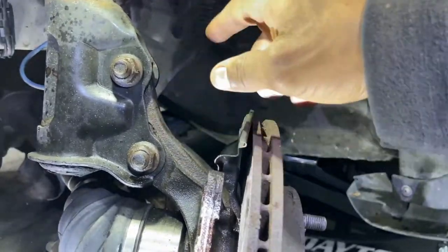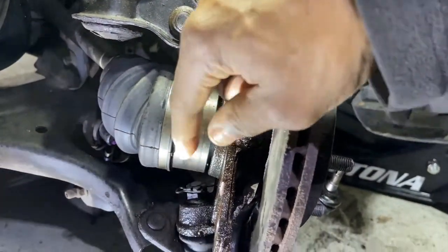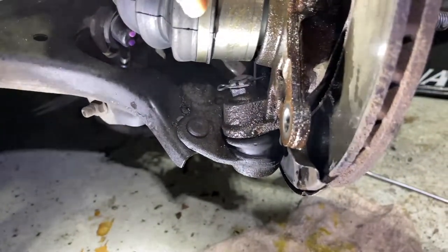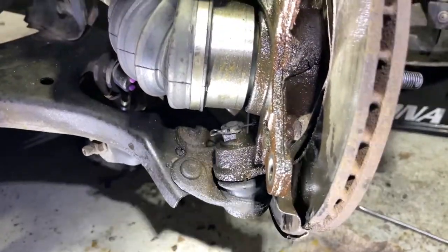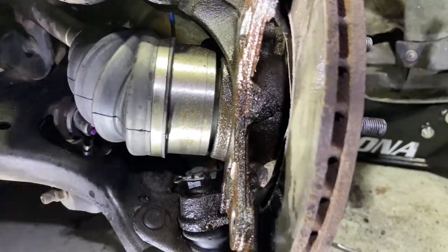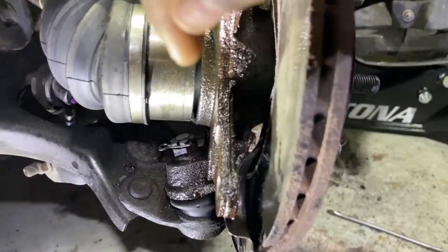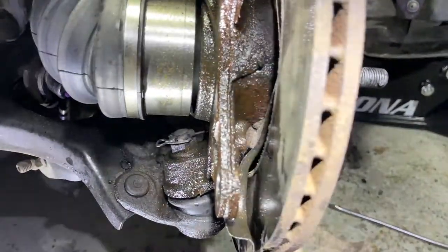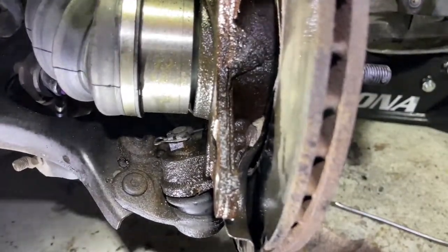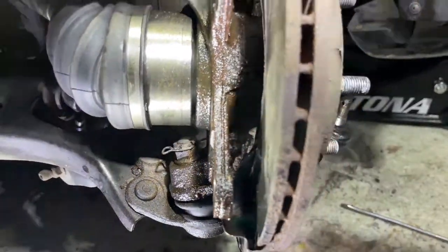We'll wait to take these off last — we don't want the spindle dropping down on us. These are 19mm nuts; we'll get these last. We're replacing the ball joint, and I recommend replacing the ball joint so we don't have to remove the castle nut separately. It's been on here a while. I just replaced this axle and that ball joint has a lot of play in it. I recommend changing it as well — it's only 30 bucks for a set. I'll put the links in the description box for all the parts. It's best to replace the ball joints, especially if they're the originals that came with the vehicle. We don't have to worry about moving it from the spindle, but we do have to remove the axle.